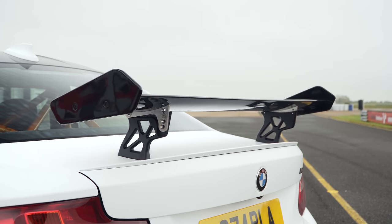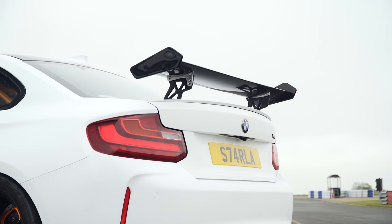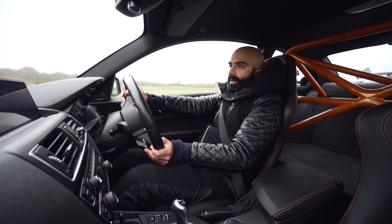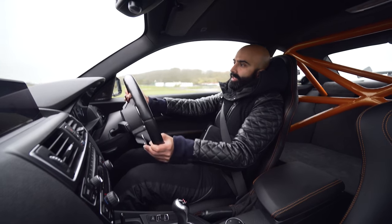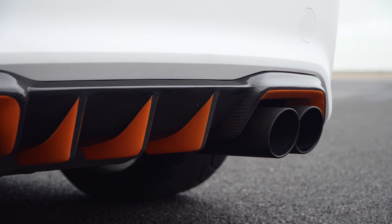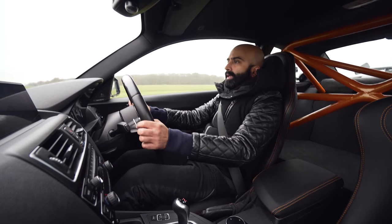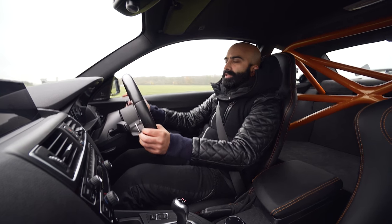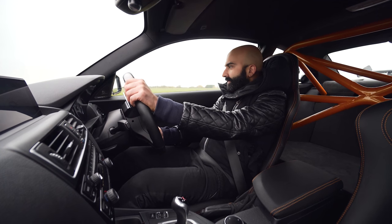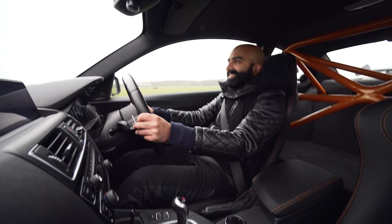The rear wing, again Edison Composites, is made in the same style as a GTS, but just in the right proportions for this car. The roof, again by Edison Composites, is carbon and is in double bubble style. Performance wise, the car has a full Supersprint exhaust, Evolve 200 cell downpipe, and it's running the Evolve backend flash on the ECU along with the JB4 and methanol injection, which we're running 50-50 water and meth, so that's the same as the M4 GTS.